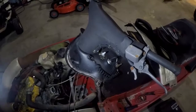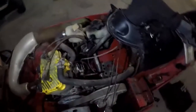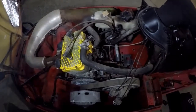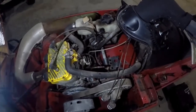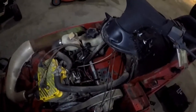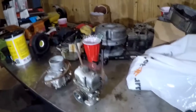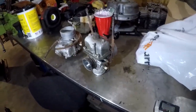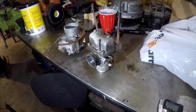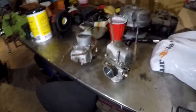Got the jackshaft for the Jag and working on the Big Bear. Got some new BR9 solid core plugs for it. Right now I need to get the fuel lines done, then it's a waiting game for parts. Once I get the new carb flanges we can install the carbs — they were actually dry, very empty when I pulled them off. Going to inspect them, check if they need needle seats, test if they'll hold pressure. If they do, we'll just clean them. If not, we'll get rebuild kits and rebuild them.